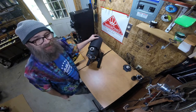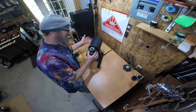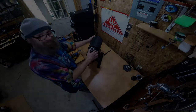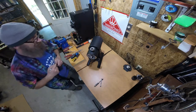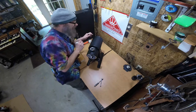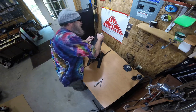The description of the job is fairly intimidating. We are going to take the front grind chamber off and take the back plate off — that is where the centrifugal switch is attached. Before starting this job, I like to find a place where you can't see a mark and draw a line between the body and the grind chamber, and between the body and the back plate. That way when you put everything back together they line up exactly like they were.